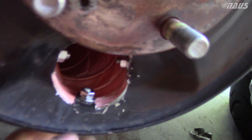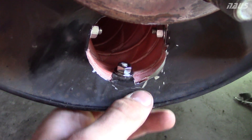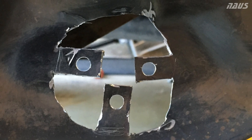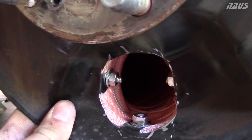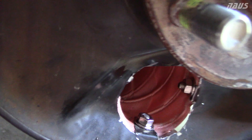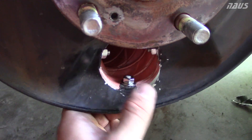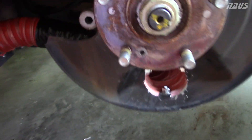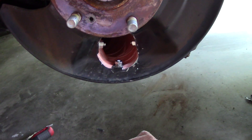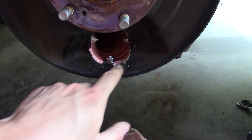This is my temporary solution. When I was cutting the hole with my Dremel, I used a cutoff wheel and a sanding bit. I made tabs and didn't cut them off before making the circle, then bent the tabs back, cleaned them up with the Dremel sanding bit, and made sure nothing sharp was poking the hose. I grabbed some quarter-twenty hardware and bolted three tabs to the silicone hose. The bolts might disrupt flow marginally, but it's a great makeshift way to get to the track. When I get the flanges in the mail, I'll cut the tabs off, make it more circular, drill holes, and bolt the flange on.